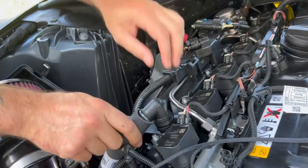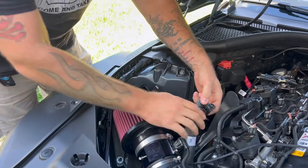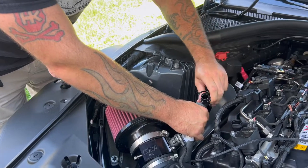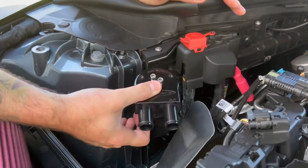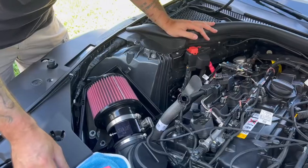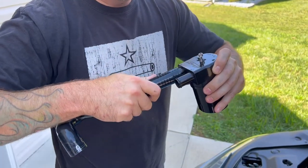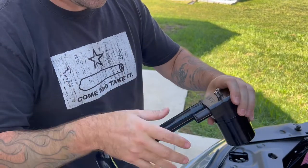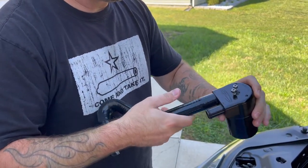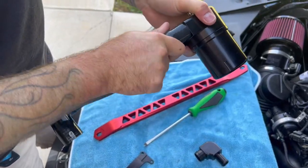Come over here to your PCV — this is hot, so be careful. This right here is going to twist up, and then we're going to mount our catch can right about here in whatever direction we want. The hoses have flared ends, so you just shove them on — you don't need clamps or anything to hold it down. It's not going to go anywhere, it's not going to leak.